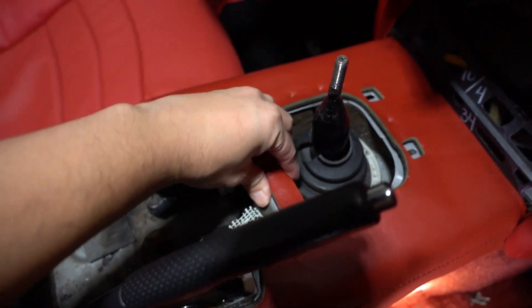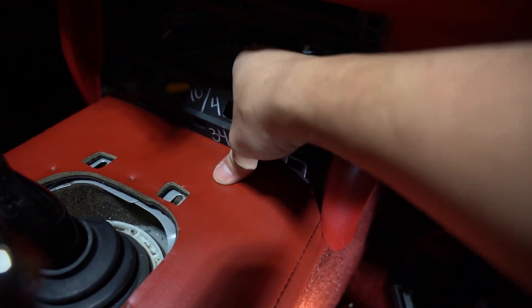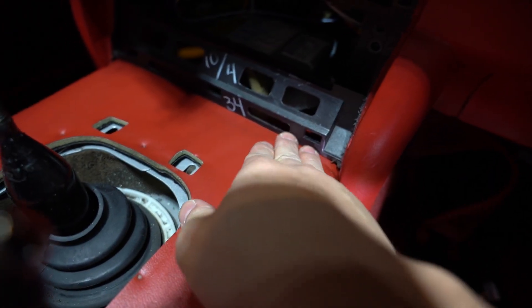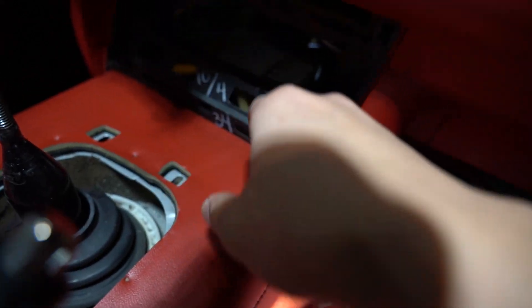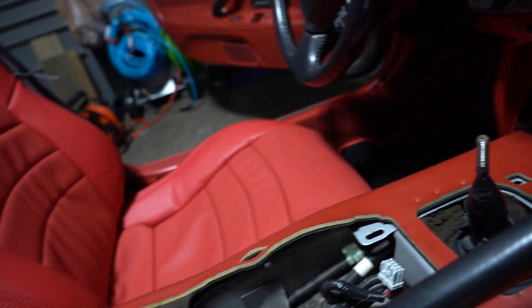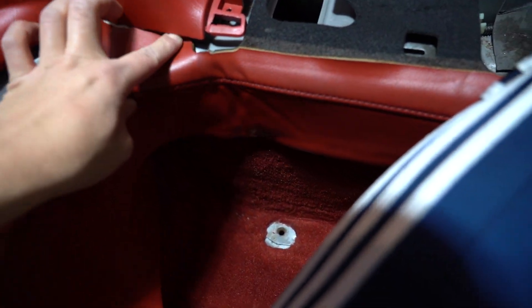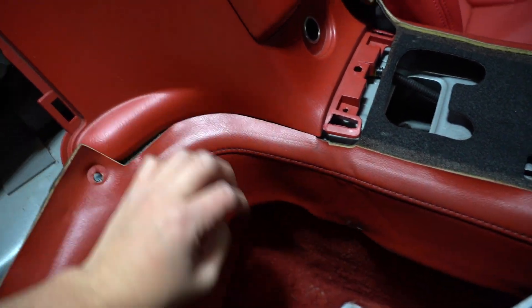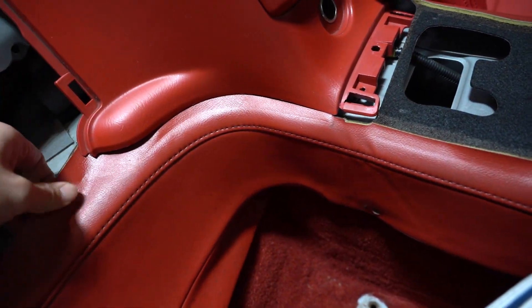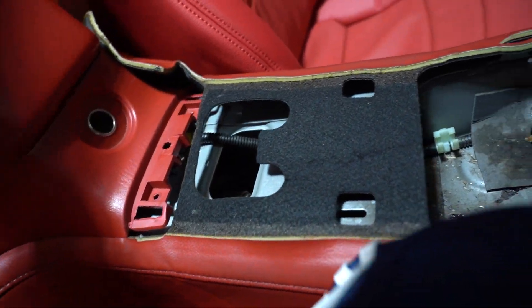Okay, so I think this is roughly in place now. You just want to make sure this little center section here lines up with that little metal tab. As you guys could see, I had to just slowly massage this in by lifting this up and down a little bit while pushing in on the leather. The rest is pretty simple — we're just gonna line this stuff back underneath the center console here like that. Pretty easy, and then do the same on the other side of course.